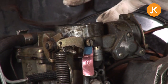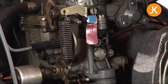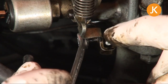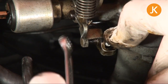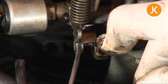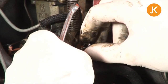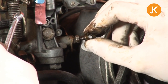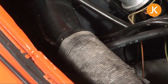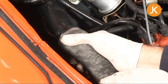With the air filter removed from the top of the carburettor, we look for the spring and the operating lever on the side. We're looking for the 8mm little bolt down here, which holds the accelerator cable in place. There are various ways you can do it, but when undoing it you need to hold on — if you're not strong enough, you can always put a pair of pliers on there and then just literally undo it. Make sure you put the barrel clamp somewhere very safe where you're going to find it again, preferably in one of the little magnetic dishes. Next we need to take off the air hosing that powers up your heating system — usually a sharp pull and a little twist and they'll come off.